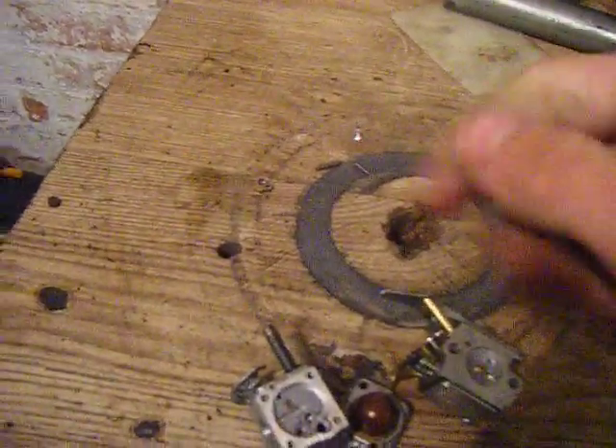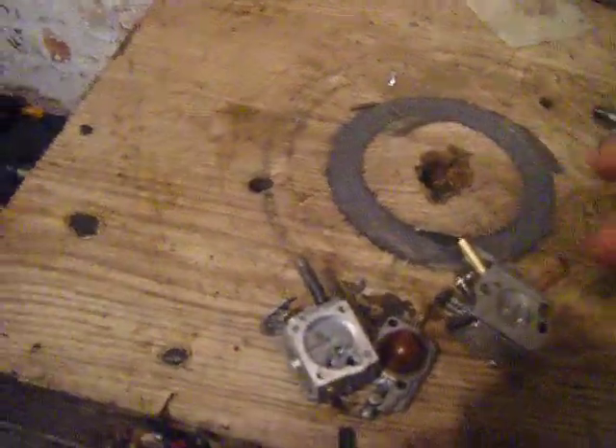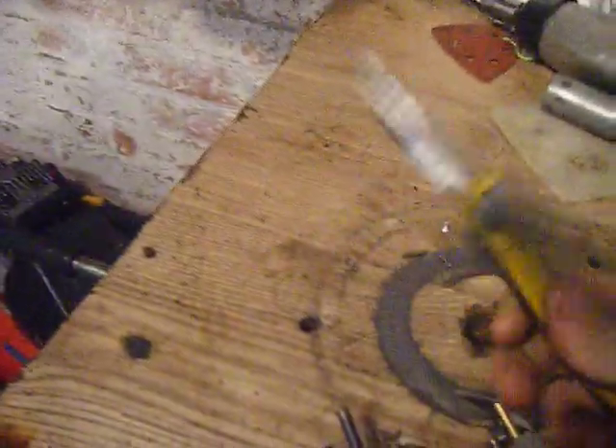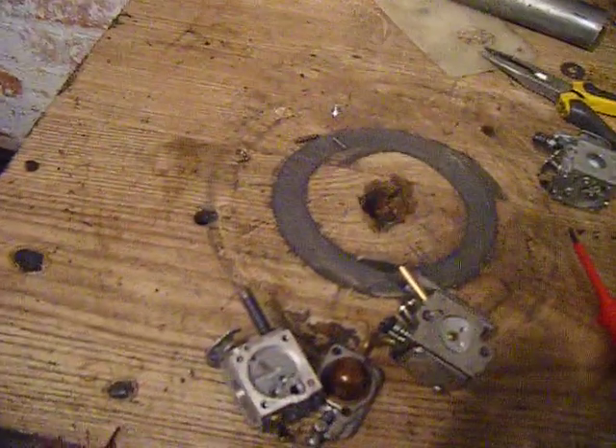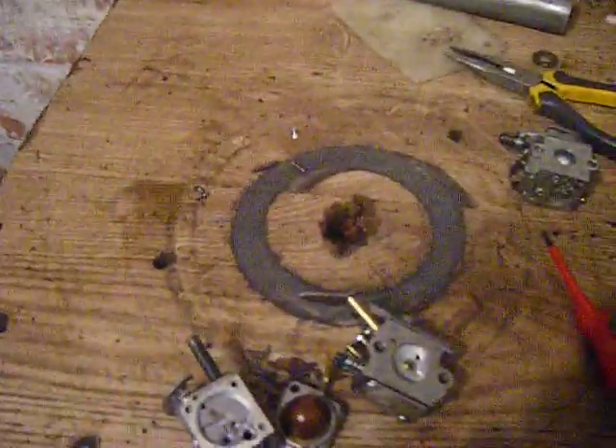If you've just got the plastic limiters — which have kind of a flat head on the top so you can try and move them with a screwdriver, but they won't turn because they're hitting each other and they just don't adjust enough — grab your nose-point pliers, just like this, and take them off. It won't do any harm, and you're going to get some more power out of it. That's that — I'll see you guys later. Bye.